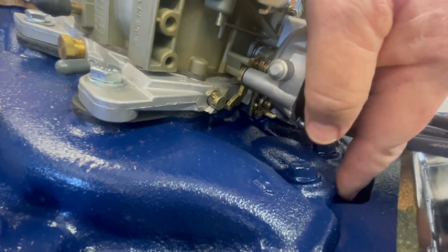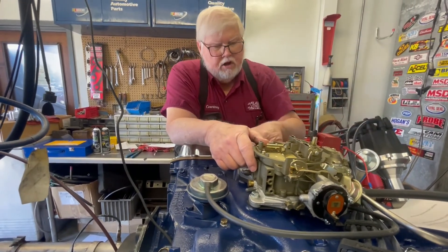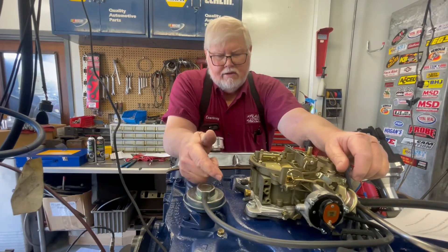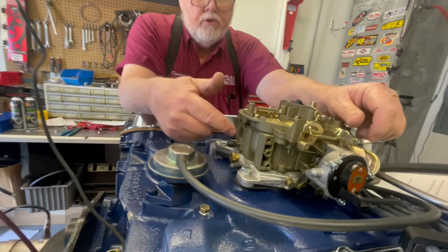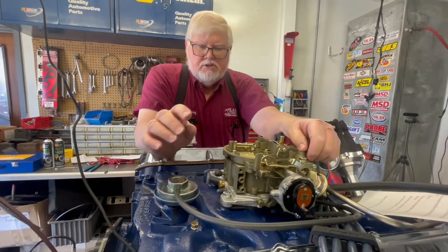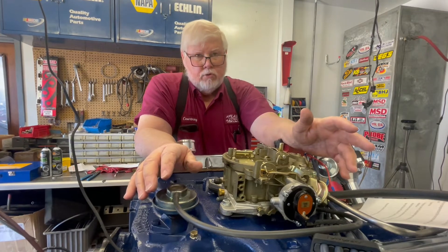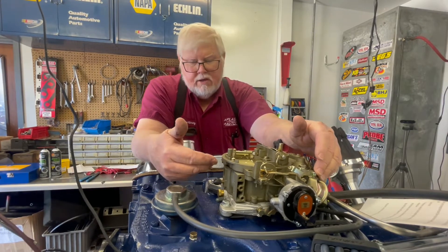I think it's kind of like a cooling effect because it gets awful hot. You've got exhaust coming across underneath the carburetor to help in cold starts and warming up. They tapped into that exhaust port — there are two holes here. One goes to the exhaust port, the other goes to a couple of passages underneath the carburetor. Take the carburetor off and you see the little passages pointing straight up. The idea is they're taking exhaust gas, which should have no oxygen left in it and very little fuel, and putting it back into the intake manifold to be recycled.